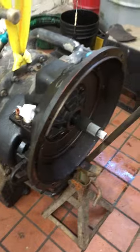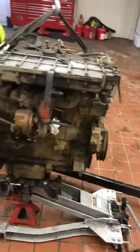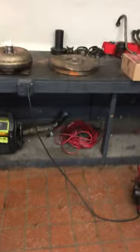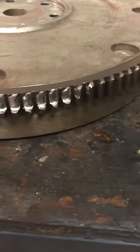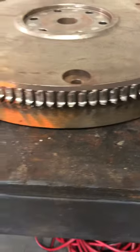This is the transmission. They were having trouble starting it — sounded like the starter was just spinning around and around and not cranking the engine over. Sure enough, when I looked at the inspection plate, I could see that the ring gear was all chewed up real good. It's probably been like that for a while, probably skipped a bunch and then finally got to where it couldn't catch anymore.